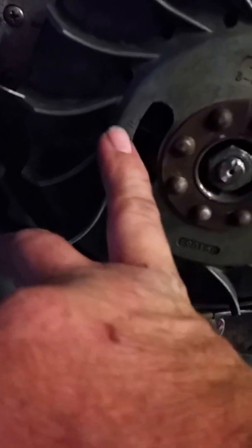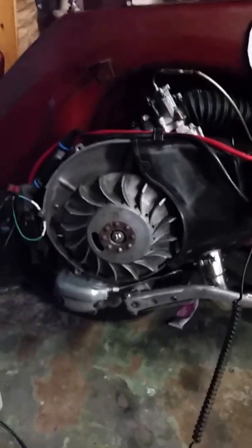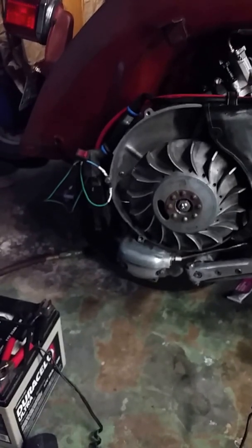When I line it up at 18 degrees before top dead center, I've used the degree wheel to find everything. I've done it all — everything's right. If I set this at 18 degrees before top dead center and look in here, the marks on the flywheel are lined up exactly with the marks on the pickup coil. So common sense says this thing is set for 18 degrees before top dead center. You can see the stock mark on the stator — that's 23 degrees before top dead center, but you have to retard it a little for the higher compression cylinder.